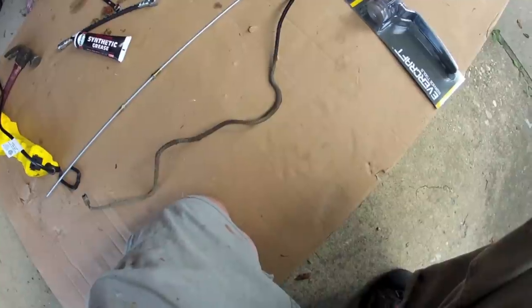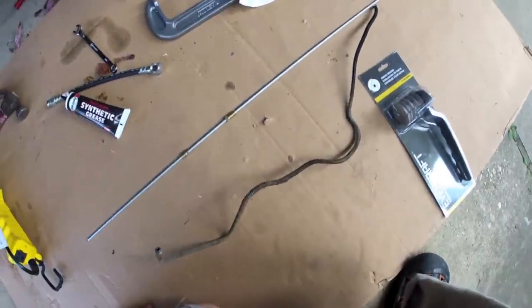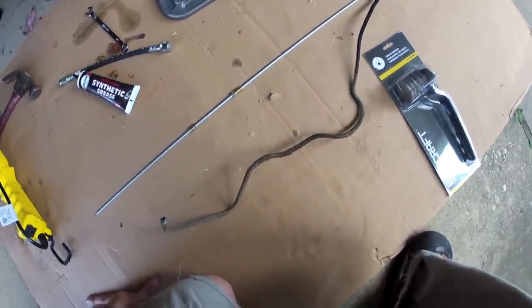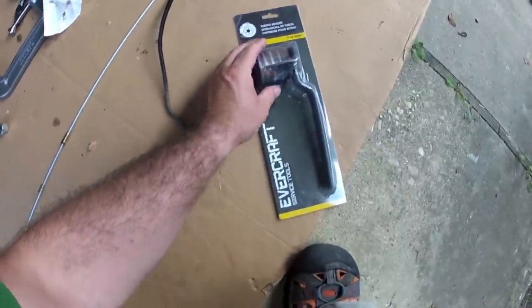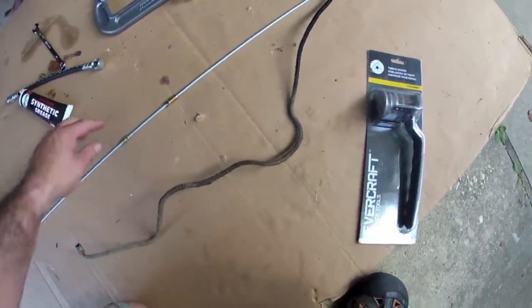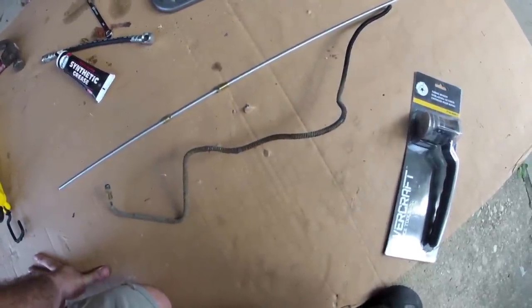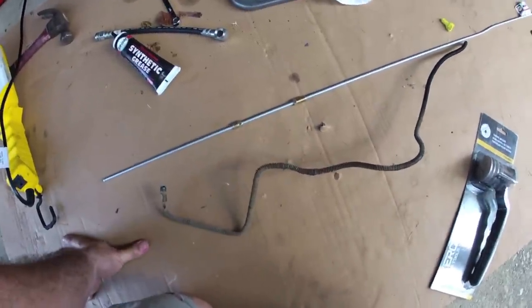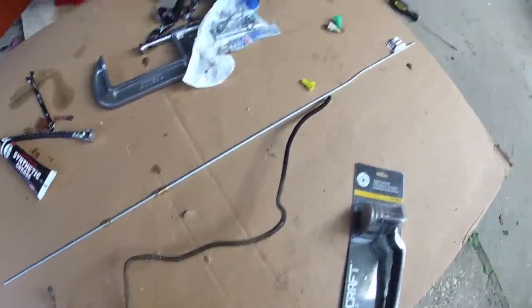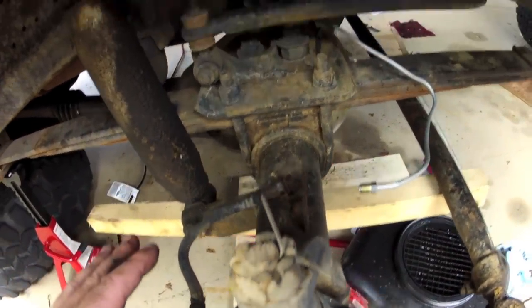Back from the parts store — here's my original piece and here's the new piece. I believe it's gonna be too long, and they wanted to charge me like 75 bucks for a flare kit to flare this. So what I'm gonna do is I bought this relatively cheap tubing bender, bend it as close as I can to this, set it up, then go to the auto mechanic shop and hopefully they'll cut and re-flare it for a reasonable price. I got my new brake line lined up, taking this one off, and we'll be installing the new one.